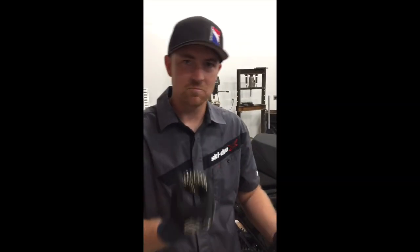Gear down, not a kit, just a gear down. Okay, we are changing the gear ratio in this sled. So we're changing out the top gear. We're doing this because we want to have more low-end torque. We want to be able to hit harder coming off the line. Mostly, I'm not worried about top speed because we're tree riding.